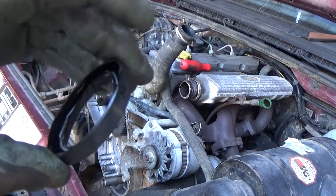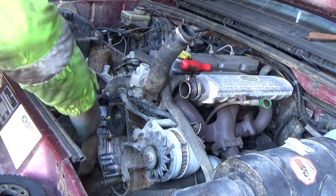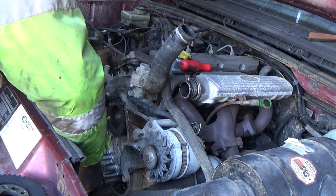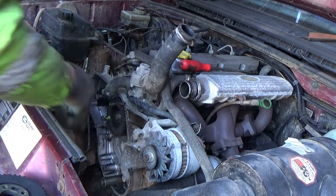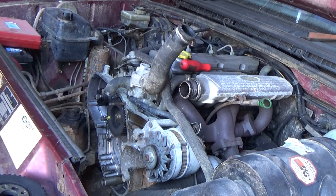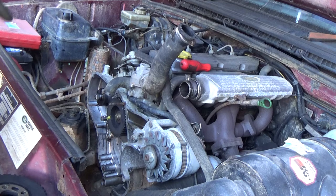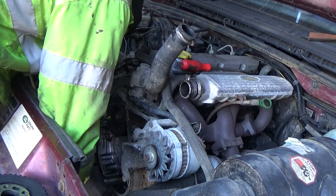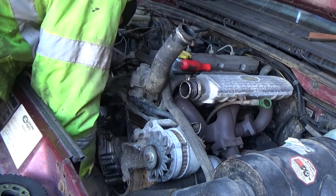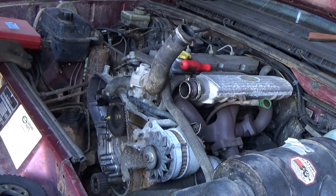The first thing I've been doing this morning is changing the oil seals, so that we don't get any oil leaks on our nice new cam belt. The bottom pulley is a bit of a nightmare to fit or take off. What I'm suggesting is that you cover the crankshaft in oil, and also cover the sealing surface in oil as well, just to help it on that first start and prevent it from seizing.